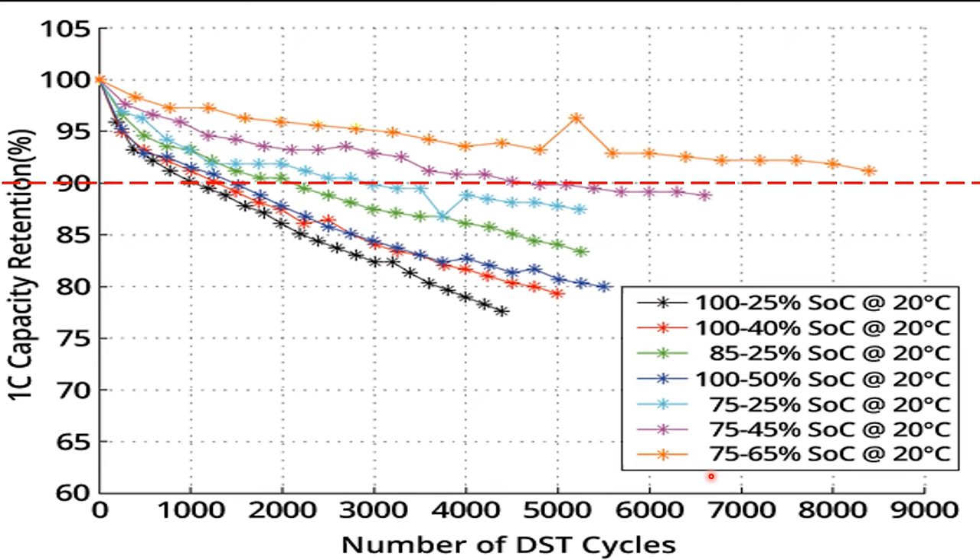Of course, you might say isn't that a waste of a battery — you've got enormous capacity and you're only using 10% of it. Well, it turns out that most people in developed countries drive less than 20 kilometres or 13 miles each day when they commute, based on many studies across many nations. So if those people are traveling just 20 kilometres, getting home and plugging the car back in, they're literally only using 10% or less of the battery energy and topping it up 10%. The only difference is they're probably charging back up to 85% or 90% because that's what the manufacturer instructed. However, if they lowered that maximum state of charge to 75% — or even lower — they would get more life out of the battery.